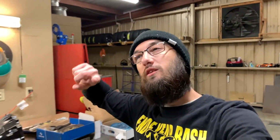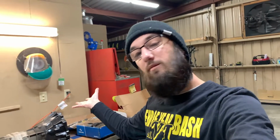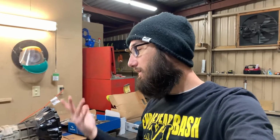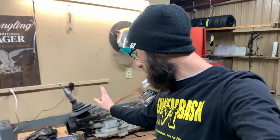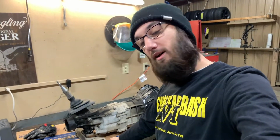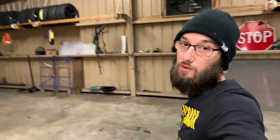And the car, as you can see behind me, is not in my garage. So that's over at No Drift Shop because I started on this last night. We got the car racked and it's not gonna get done this weekend because I have to measure to get a drive shaft made. So it'll go in, but the car won't be mobile until the drive shaft comes in. Still have some variables to work out, like the trans mount. Bring you guys along for that, the wiring, and clean this thing up and the whole adventure. So let's just pop over to No Drift Shop because I think I heard Dom pull up, and we'll get to cracking because we got a lot of work to do.